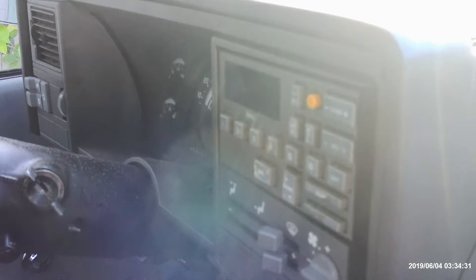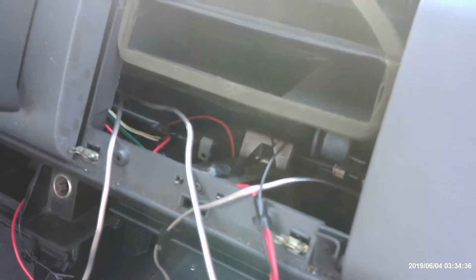See this? There's your factory unit. You can keep that. The clock will work. The cassette that is in here, all you do is unplug it and tape it off. That's all you do. It's right here — it plugged into the back of the cassette. All I did was unplug it, tape it off, and the clock still works with the key ignition.